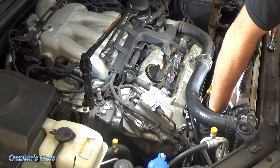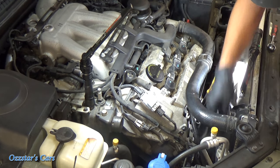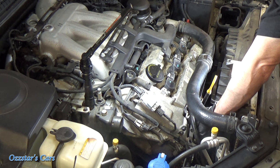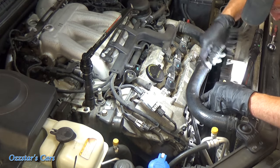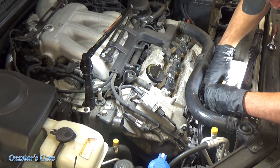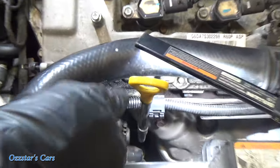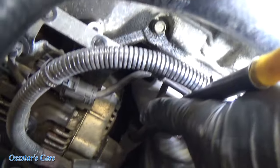Now I'm taking a bolt out of the oil dipstick tube bracket — you can see that yellow dipstick. It's a bigger bolt, a 12 millimeter; most of the other stuff is 10. What I'm going to do is just push this back and get this harness out of the way. This bolt came out of this area right down here — there's a bracket for this dipstick tube, right back where my finger is. Take that out and you can push things back a little bit.